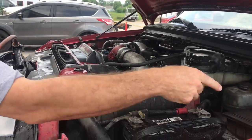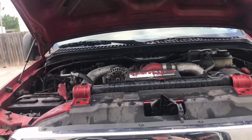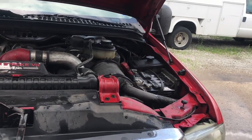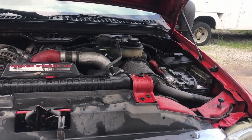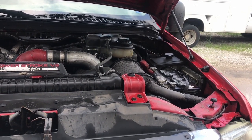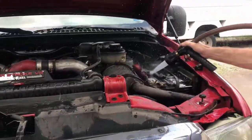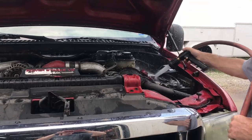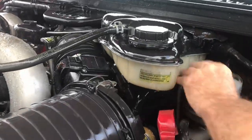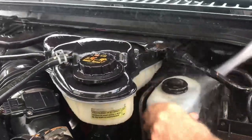Don't even start with the batteries looking like that — see that green corrosion. That's the first thing I'm going to address. If you use hot water, watch what this thing does — it gets it everywhere. Use a little common sense around the alternator and the belts. Most of the other stuff under here is absolutely waterproof. Watch what hot water does — that's just hot water. See all that? It doesn't take much to clean it off.